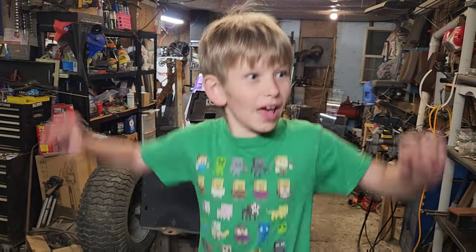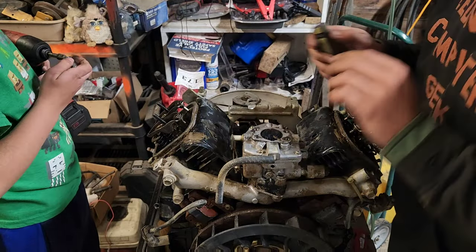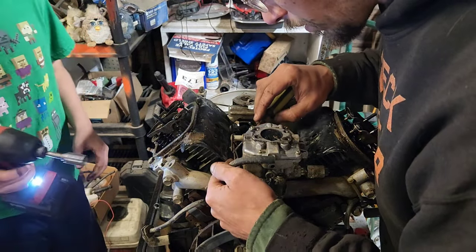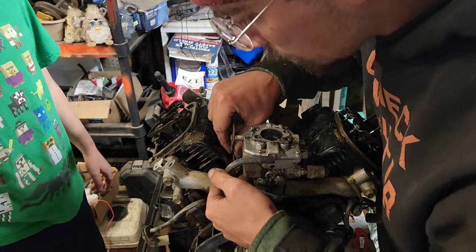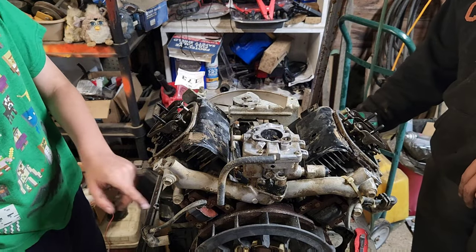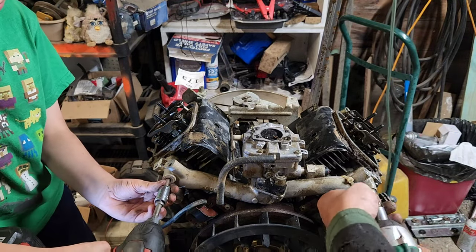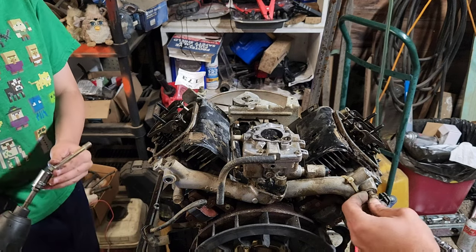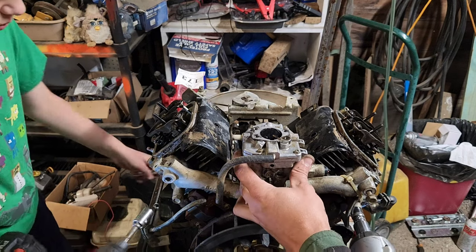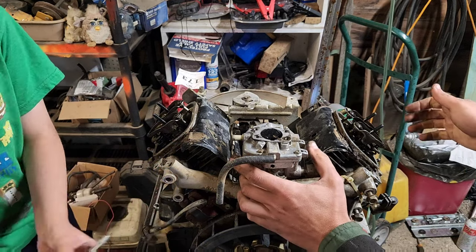You ready? Yes! Okay. Alright, so let's get the spring undone, like we said we were going to do on the video. There's that. So now those are disconnected from each other. And you can go ahead and pop those. And this whole entire intake should fall off. So you go ahead and pop this one while I hold it. And I believe the whole thing should pop off, plus or minus it being stuck with years worth of corrosion.